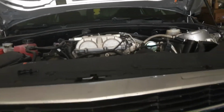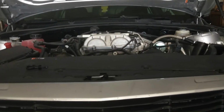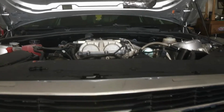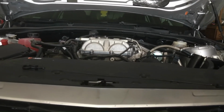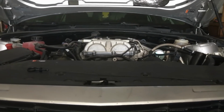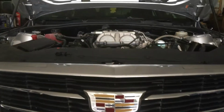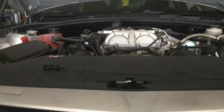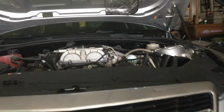Barely fit for a lawnmower, but that's all we got here in the States. But you go to other countries, they got 100 right at the pumps. Well, you go to the airport and you look for reciprocating engine fuel, which is avgas. The other stuff you don't put in there. It's called JP fuel. Don't put JP fuel in your gas engine because it's diesel type fuel. It works on jet engines and it works on diesel engines, but it does not work on gas engines. So always put the avgas.